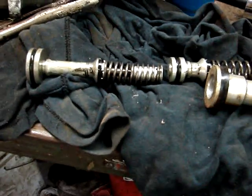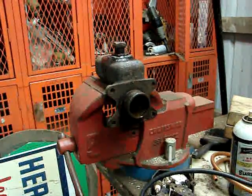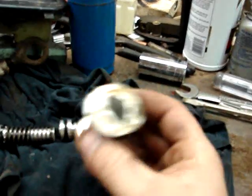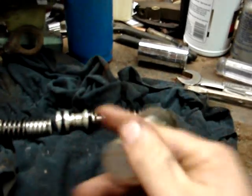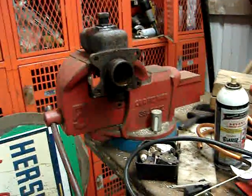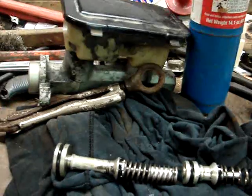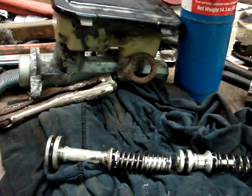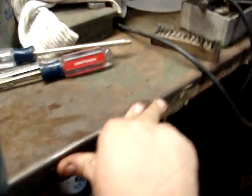So what I think I'm going to do is try to make that original master cylinder, which I've already rebuilt, work. It's apart now, but it's got all new parts in it. You can see the aluminum is just like new except for the dirt that's on it. But we're going to try to make that master cylinder fit the power booster from this, because I know that the old power booster loses fluid. It leaks by into the actual vacuum chamber. That actually sits out here yet.